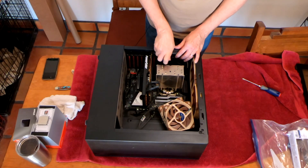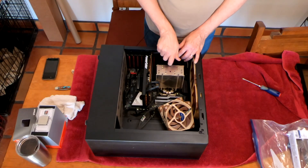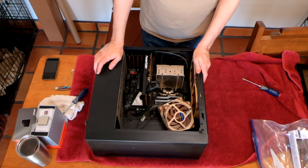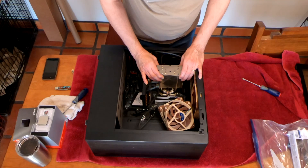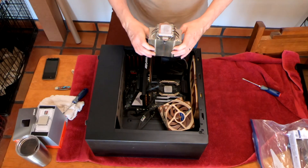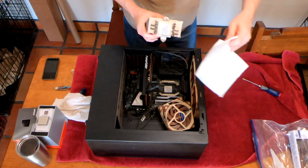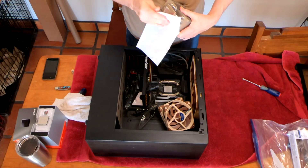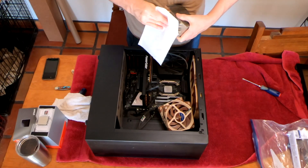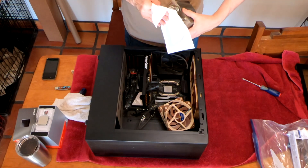Make sure your screws are all the way loose. Then what you're going to try to do is nicely pry off the cooler from the CPU. One time when I did this, the CPU got ripped out and some of the pins got bent — that's very rare but it happened. So what we're going to do is just gently rock it and remove. See how it just popped off really nicely there. Here's the heat sink and the fins — I think this has seven heat pipes. It's really nice. First thing I would do is wipe this off with a clean paper towel so it's super shiny and clean, because you're going to reuse it.